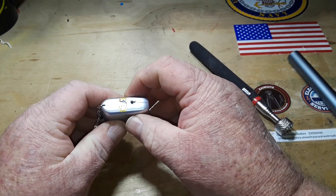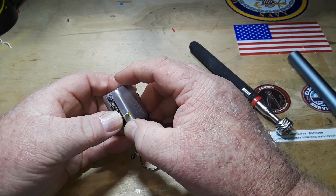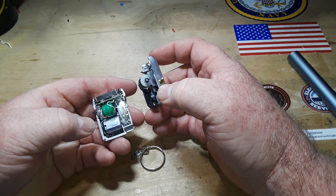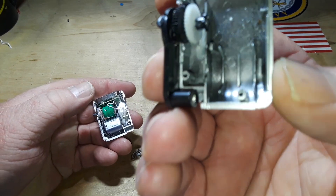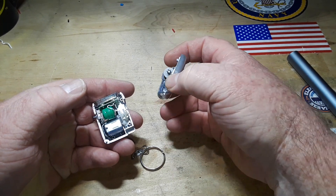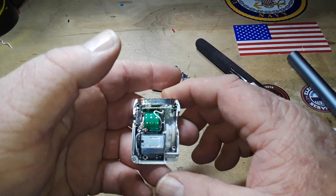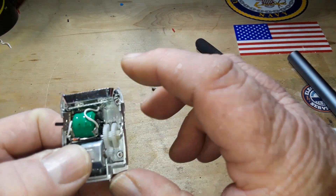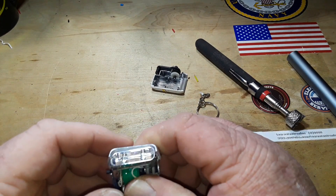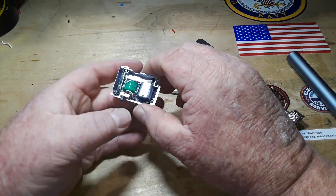Anything under the 'Made in China' sticker? No. Let's open up and see what's inside. We've got our mechanicals — that's the driver, the crank to turn the gears. Now if we look in here, this looks like three tiny little button cells, and I bet that's what went bad. The little button cells have probably died.